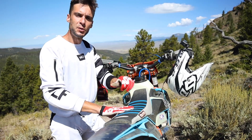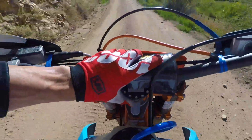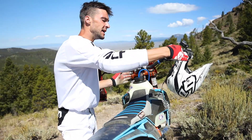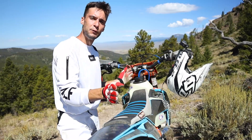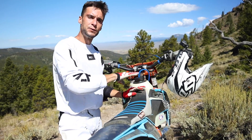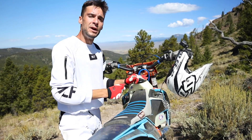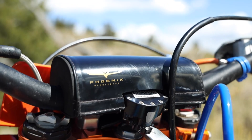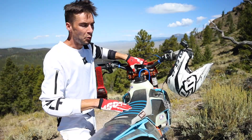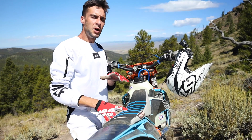It has 20 low-speed dampening points on this wheel here, adjustable easily while you're riding, and then 10 high-speed adjustables from underneath, each with an indentation you can feel as you go. It's smooth dampening all the way across the range — it doesn't have the hard stop at 15, 30, or 45 degrees like other brands. It's just a smooth taper, which is really nice for motocross guys. When you're in the air for a hundred feet or so, when you move your bars you don't want the rest of your bike moving with you. Even with a bar pad, this is easily reached.